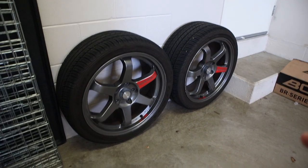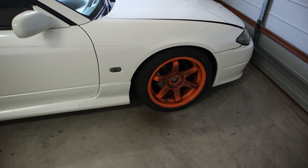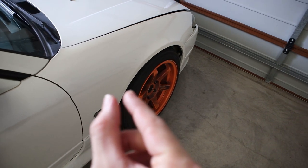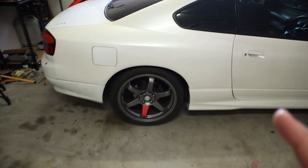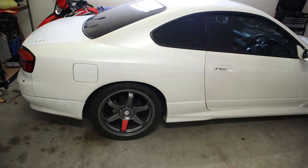It's pretty muggy here today. We've had the front coilovers on and off now about three times, maybe two. I'm sort of sick of taking them on and off, and that's because they didn't fit with my standard wheel. These are the standard wheels — 18x8 plus 35 — and they didn't clear the BC coilovers; the tyre touched on the shock or the spring part of the BCs. So that's why we've got the orange ones on at the moment. Because of the stretch tyre and more offset, they've actually got a lot more offset but it makes a little bit more clearance on the inside. So these ones clear, these ones don't. But the rear has currently still got the old shocks on it, so we're going to fit up the BCs to the rear. There's no clearance issues at the back of this car. So we'll fit the rear ones up and get this thing handling and looking a bit better with a bit of reduced ride height.